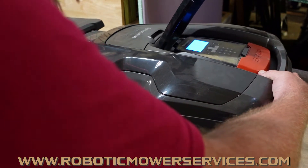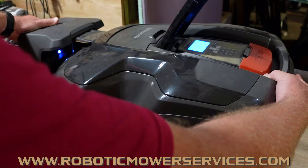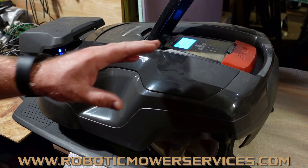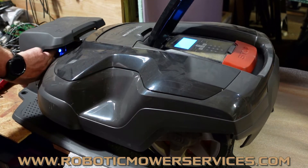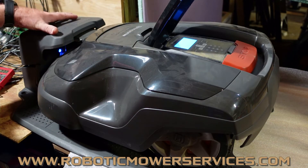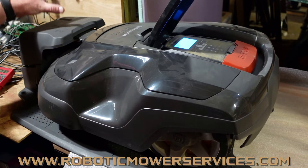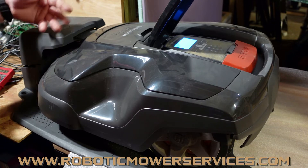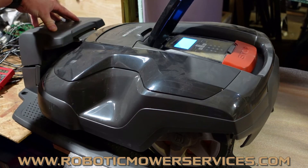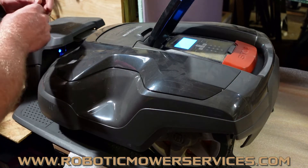If you push the mower in and get a connected tone and then a disconnected tone right after, look at your LED. Make sure it's still lit up, because sometimes it's too much load for the charging station board. If you haven't looked inside it yet, the charging station board probably has dead insects arcing across it or some snail trail residue — that's 99% of the time what the problem is when you put the mower in and everything goes dead.